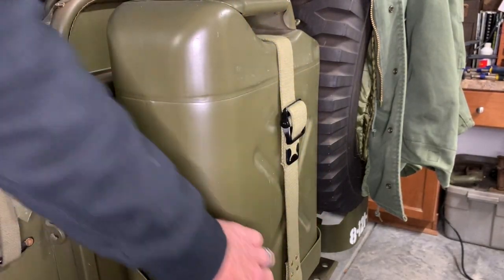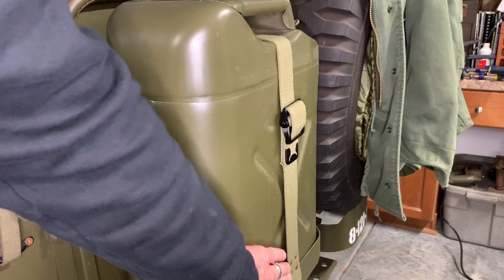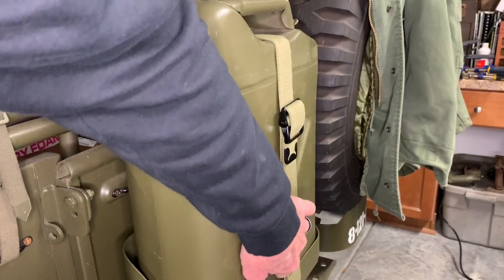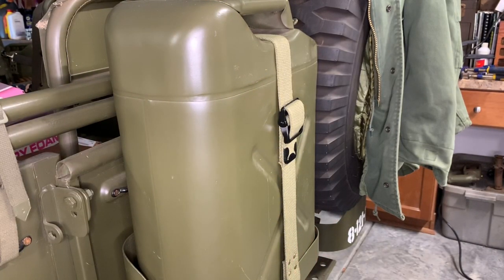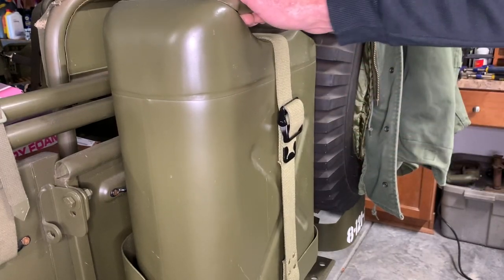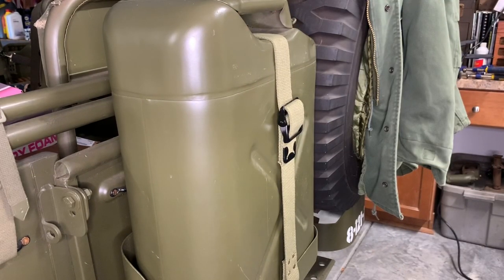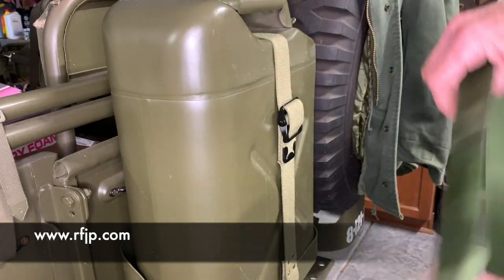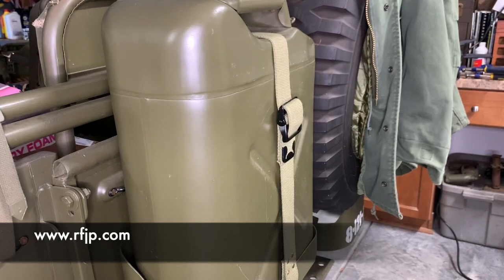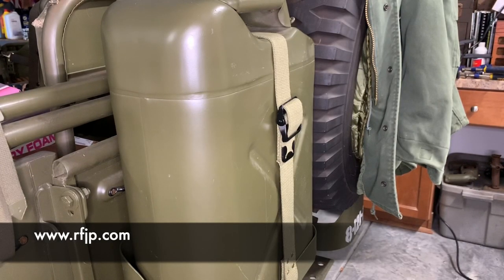In the video it went really quick and I made it look easy, but you have to be really patient with these rivets. They are long enough, they work, and they're actually the perfect size for those two folds of the webbing. It took me about 20 minutes per side per four rivets. I'm real happy with the result — way happier than what I used to have. Thanks to Ron Fitzpatrick and Ron Fitzpatrick Jeep Parts, as well as Joe's Motor Pool for the fine quality products. Until next time, keep it safe and happy jeeping!